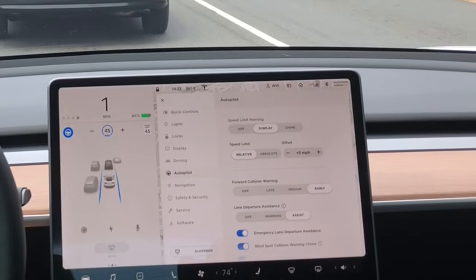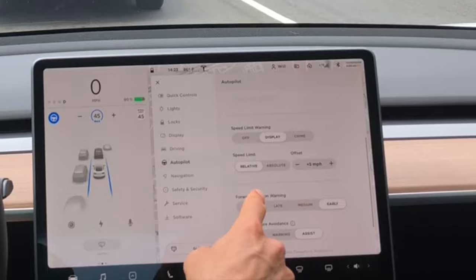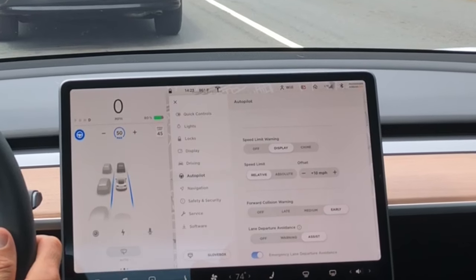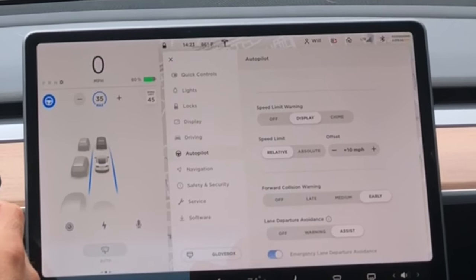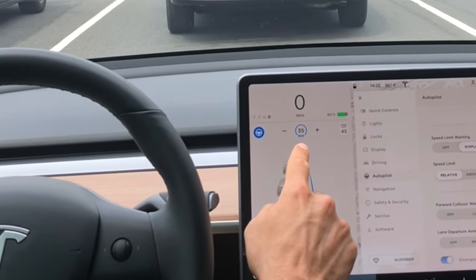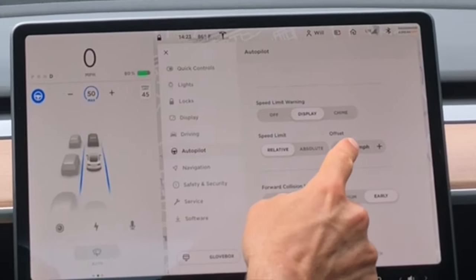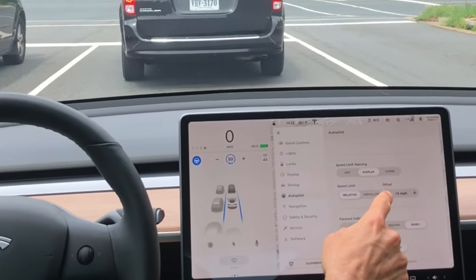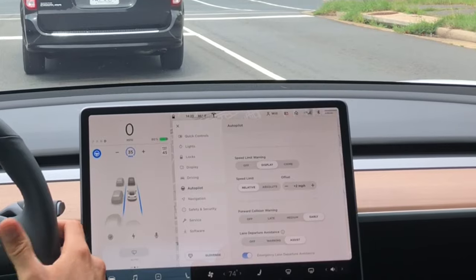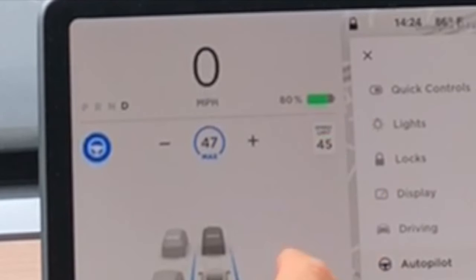I have it set to the relative speed plus five. Roads with traffic lights limit autopilot speed to five miles per hour over the posted speed limit. So even if I change my relative speed to plus ten and use the max speed shortcut by hitting the speed limit sign on your center display, it'll only go to five miles per hour over because it's limited. Just to show you how relative speed works, we'll set it to plus two, then scroll down to 35 and hit 45 again, and it's going to go up to 47.